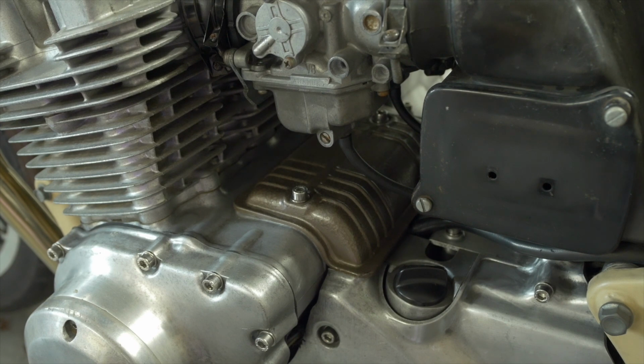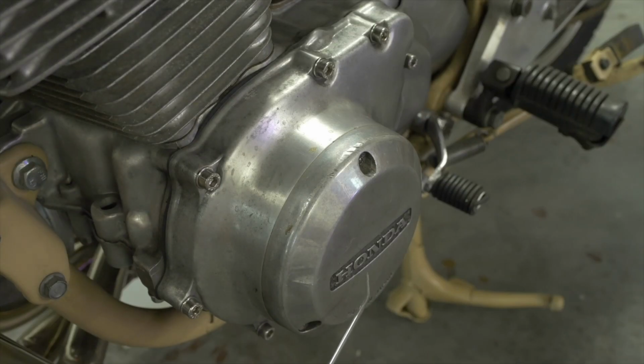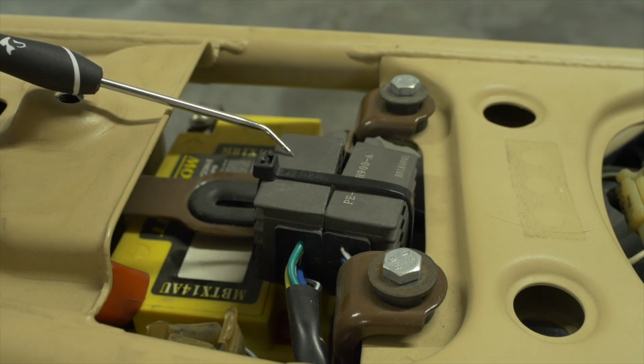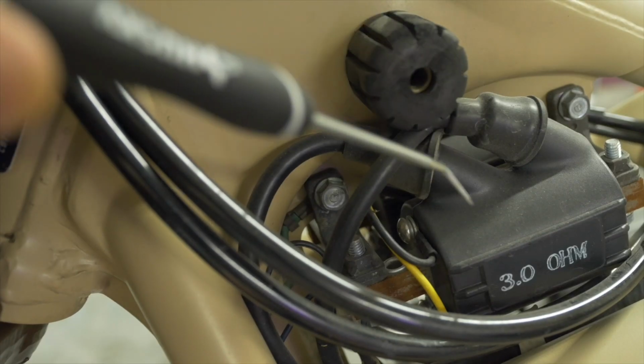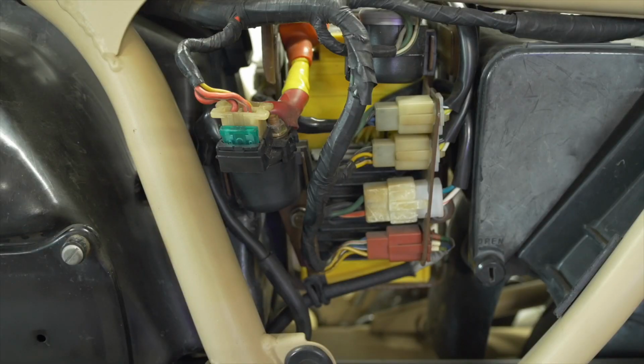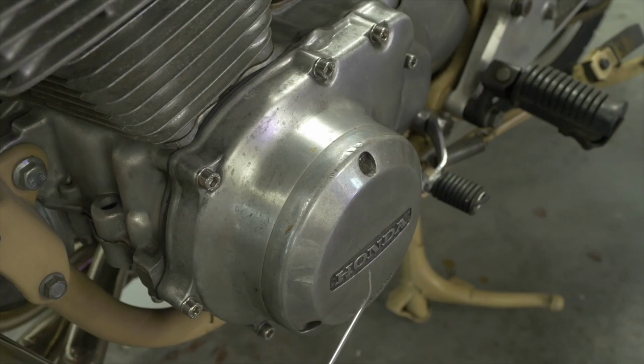Moving on to ignition. The ignition system comprises, in the direction of energy flow, the pulsars, CDI boxes, also called spark igniters, ignition coils and coil leads, and the spark plugs. There's not a lot to troubleshoot actively here, as it's kind of impossible to do while the bike is running. There's just nowhere to plug your meter in. If you want a closer look at pulsars and how they relate to ignition timing, you can check out the first video I did about scheduled maintenance.